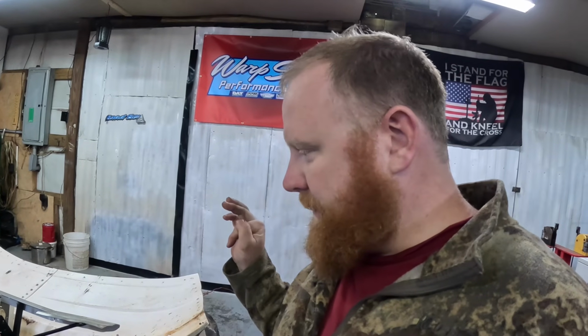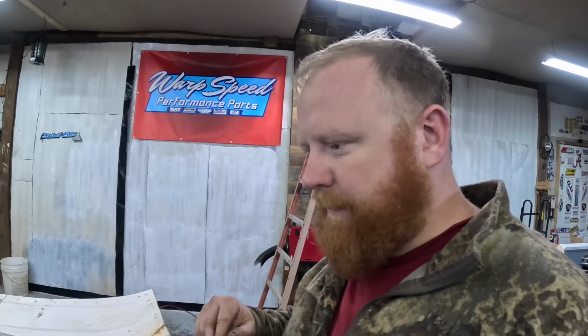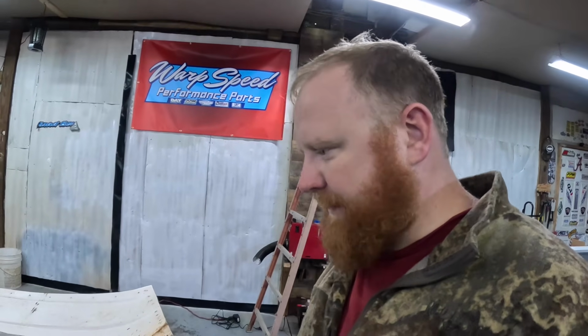And I'm gonna try to bust this thing off tomorrow. I'm gonna pull the valve covers off and just take a look at the valves and the rockers before we spin it over or bust it off or anything. Just pulled the oil. Oil looks good. It almost looks brand new, but I'm gonna fire it up with the oil that's in it, then change it before we go racing. Put a new oil and new filter in it before we go racing.